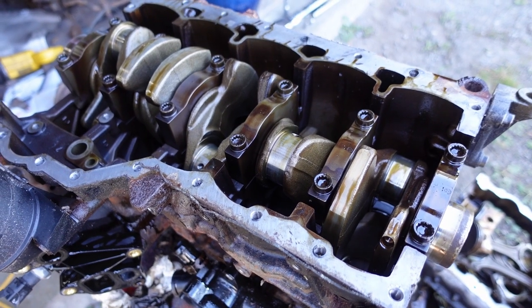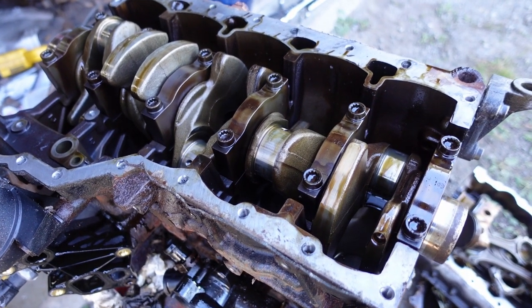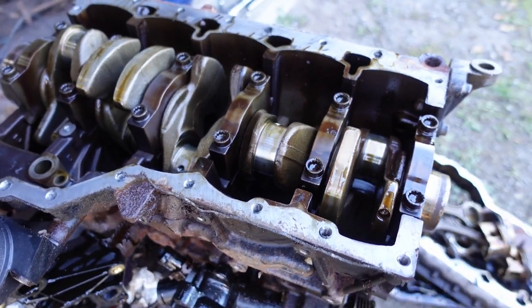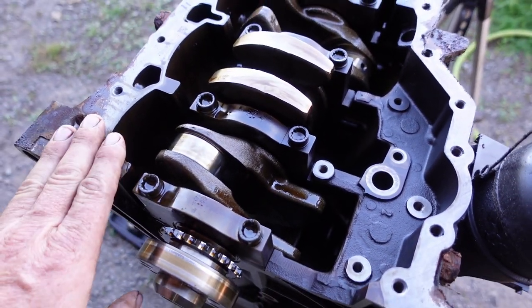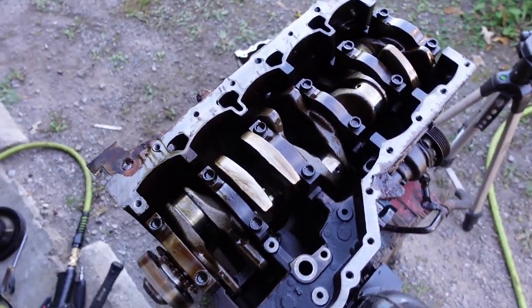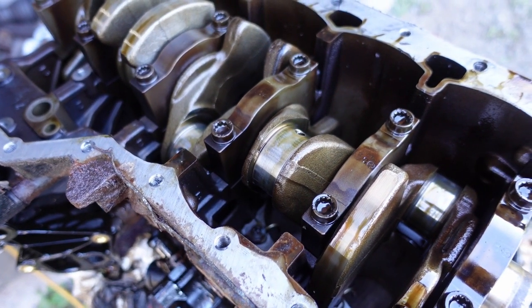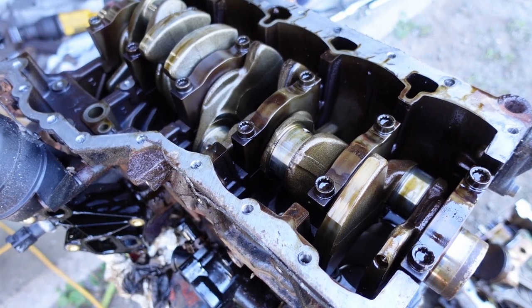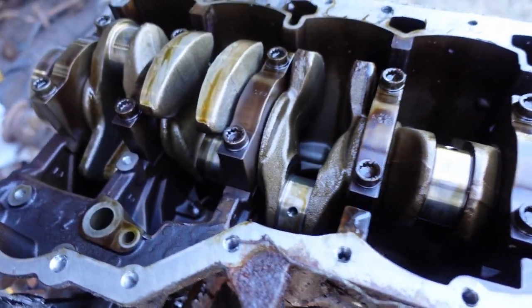I don't want to say for sure that's a problem — a T30 motor not having a forged crank — because the theory online is that all T30 bolt motors have forged cranks. I found one that didn't; who knows, it could have been a warranty replacement crankshaft or some other situation. Thanks for watching. I'd love to find some with forged crankshafts and 10 millimeter head bolts to bust that theory. Hopefully this sets you on the right path to find some forged crankshafts and save them for your high power builds.